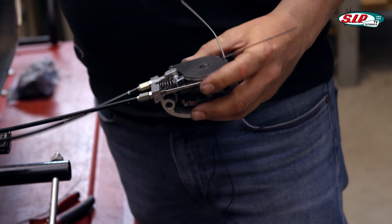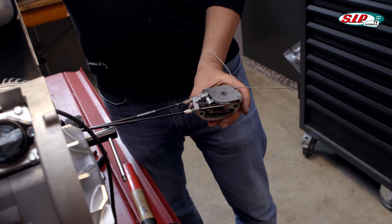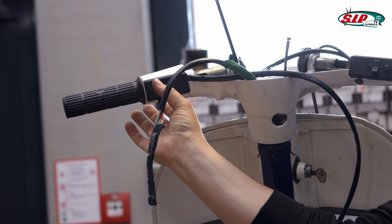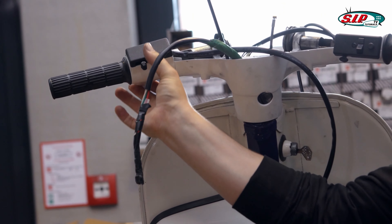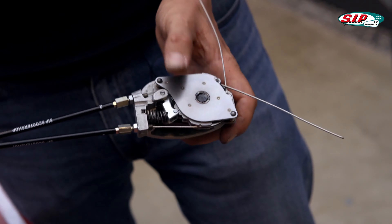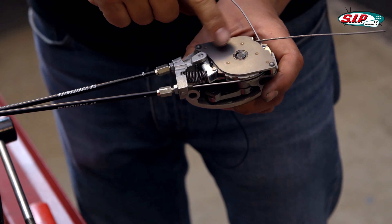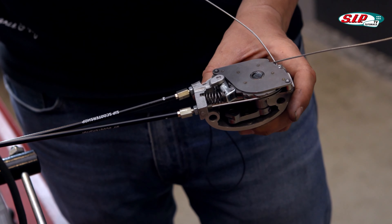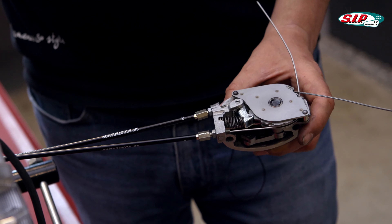And then the selector box can be mounted. Now you can see very nicely — I tightened the cables too much and now it's no longer flipping back to the starting position. Now it stops there, and that means I can't shift into the next gear because the catch below is not released. Now I'm in second gear. I'll select the third — and as you can see, it doesn't go all the way back. And if this doesn't go to the starting position, the catch will not be released either, and I can't switch to the fourth. So it's very important that it keeps flipping back, and then I can go into fourth gear.